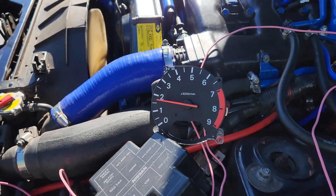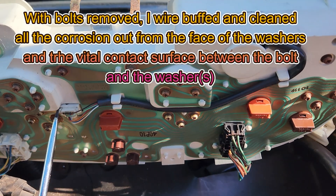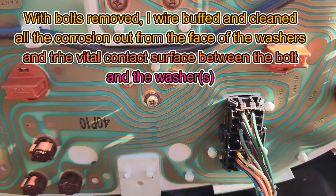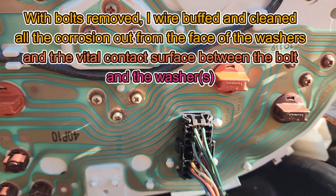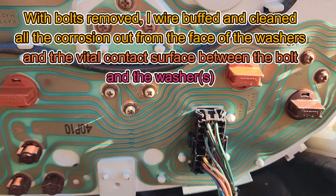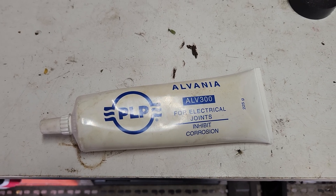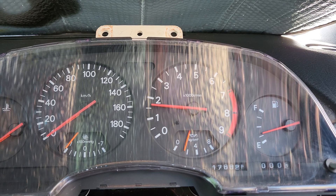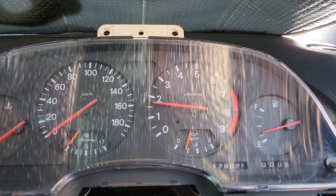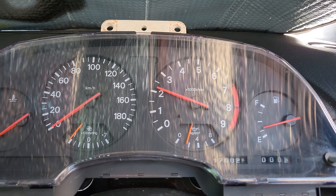So what did I do from here? I made sure I buffed all the rust off all three bolts and the washers to make sure that the current can travel through the washer and the bolts. They were quite rusty and I think the rust was inhibiting any kind of current traveling to the tachometer. I also added some dielectric grease, which is a rust inhibitor but it also allows electrical conductivity to allow current to flow through into the gauge and allow the gauge to work. And that worked for me. Hopefully any of these steps can help you diagnose whether it is the signal, the printed circuit board, corrosion on the bolts, or perhaps it is your gauge that's not working.